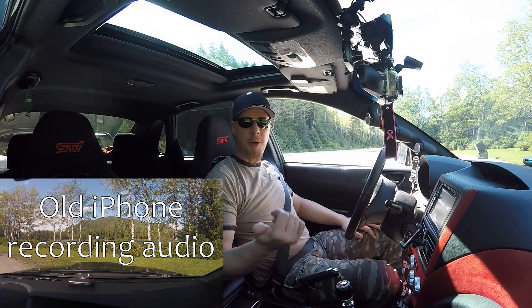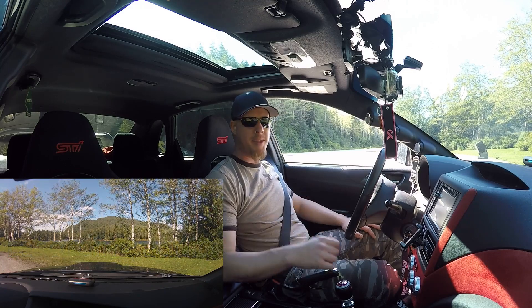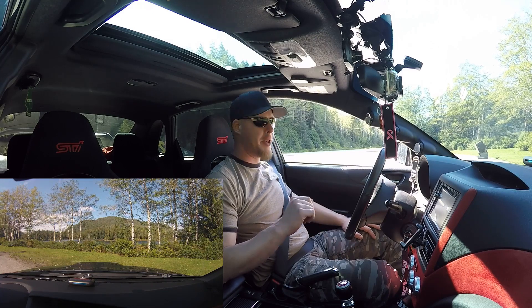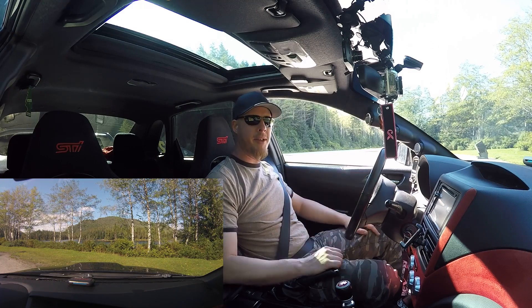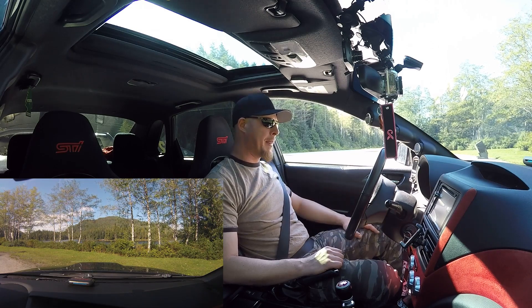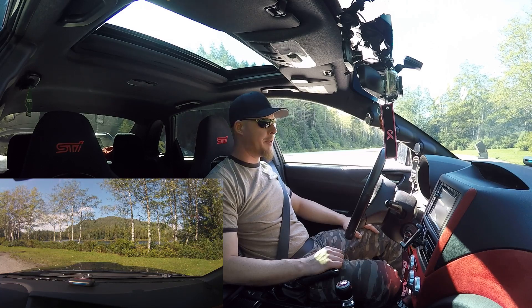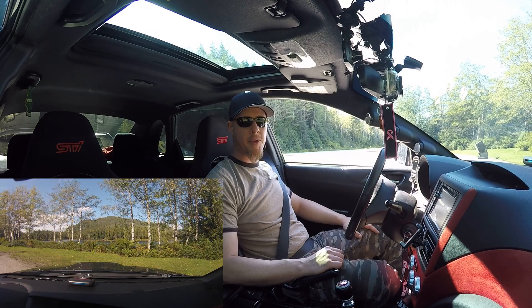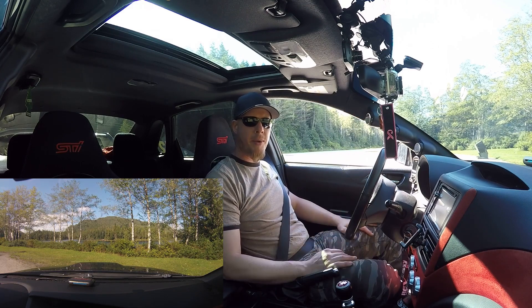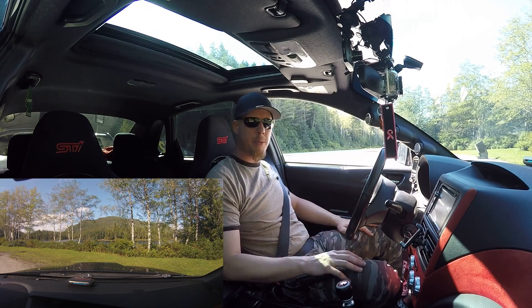I decided to come out down the highway a little bit and start the camera recording as I drive back in. The car feels really good. It does have that bit of hesitation right around 2600 to about 3000 RPM — the car gets just a tiny little shimmy. Tyler's read all over the forums and lots of people are suffering from this issue after tuning. He thinks it's fuel related, so he's planning on buying a different style fuel pressure regulator. But once you get past 3000 it really smoothens out and the boost comes on, so you can just carry the car through that hesitation.